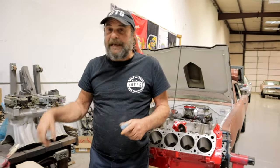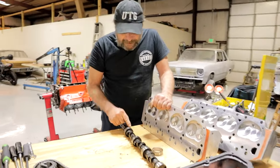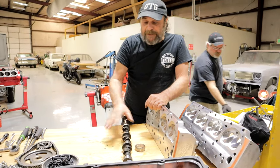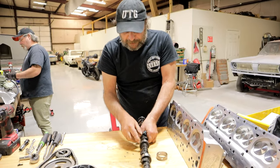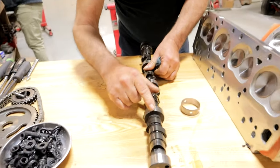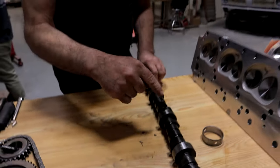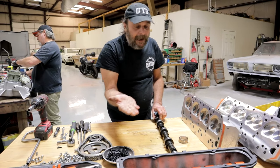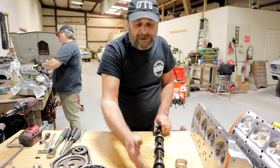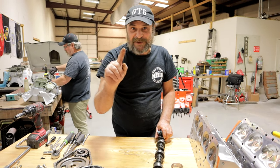This is the second quality control issue we've found with camshafts. The first was with the Hemi, where we had oversized journals, and the manufacturer took care of that for us. This is the second, and honestly I don't know what manufacturer this cam is — I stopped trying to find what it was once I realized what was going on. There's still stuff in there. Brand new stick, never run, filled with metal. This is the second manufacturer defect on cams in the last six months. This is where you come to a full stop — do not pass go, do not collect $200. That would have at least wiped out the top end of the motor, or in a worst case scenario, wiped out the entire motor.